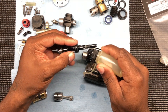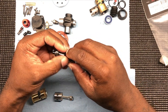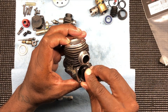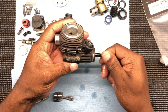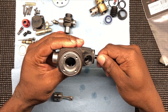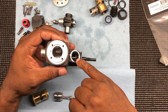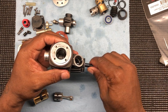3-in-1, air tool oil, whatever you got — no WD-40. Slide the crank on in there. Smooth as butter. So you want to crank — make sure you pull on that crank all the way out, all the way over. Now, I already changed the O-rings and all this stuff — there's a pile of O-rings over here. Remember, it's two O-rings down in here — one down there, one there. I already changed them, so they're new O-rings.